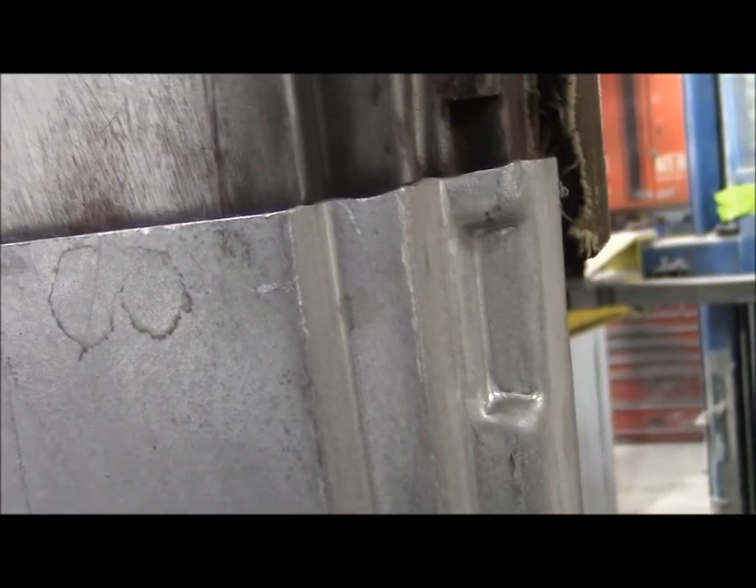Somebody loved galvanized metal — doesn't rust, does it? So what we're going to do now is cut that out and put this patch on. Normally what I do in a situation like this — not that I'm telling you guys what to do, everyone does their own thing — I lay it on here like this and draw a line right across with a felt pen, all the way across. And I'm going to cut below that line, just a hair below it. The reason is I'd sooner have a little extra left than cut way too much out, then trim it as I go along.